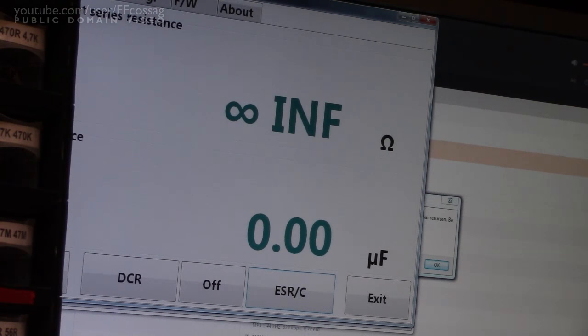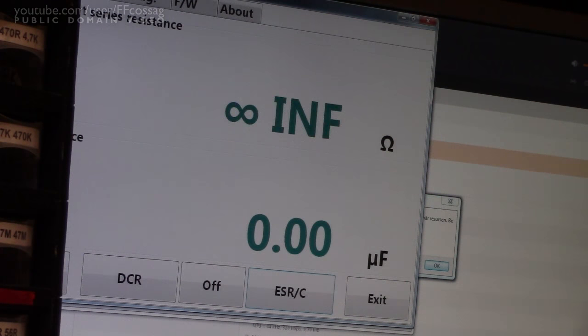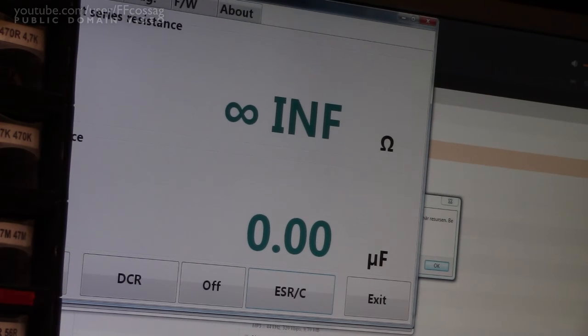Normally I would say that 1 ohm for a 47 microfarad capacitor is a bit on the high side, but it's certainly not entirely bad. Grabbing a brand new Nichicon PS 47 microfarad 50V out of the box, it's not going to be too far off - about 800mΩ and 49 microfarads - so that's not a huge difference as far as impedance is concerned. I'd basically rate these capacitors identically, within the margin of error. It must be that either something else has drifted in spec - perhaps that power resistor - or it's just been designed so close to the limit that since the capacitor dropped from 47 microfarads, bang, it's gone. Either way there's 100 microfarads there now, which should be fine for quite a considerable amount of time. Thank you for watching, cheerio.